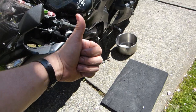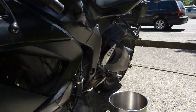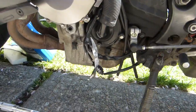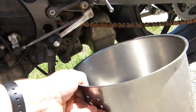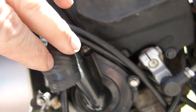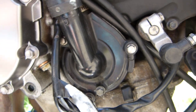It's as simple as removing one bolt and removing the radiator cap. The one bolt that gets removed is on the underside of the water pump at the lowest point typically, and all you need for it is one wrench. You're also going to need a bucket of some sort to capture the old engine coolant. If you follow the largest hose exiting the radiator, follow this big hose line here, you're gonna get to the water pump. That's how it looks when it's intact.